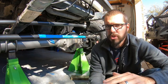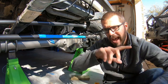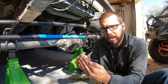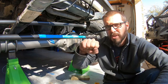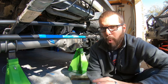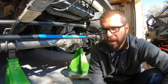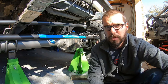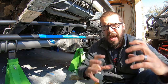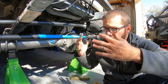That's not the best situation for long-term use unless you're aware of it, because as you turn all the way to one side, that ram will either be fully extended or fully contracted, and your steering box can put a little more pressure on the ram than it wants, and you'll blow the seals out on the ends of the ram pretty quickly. What I do is get to the end of the ram, then back off my steering just a tad to remove that pressure. It's always done me perfectly fine. Now let's get to measuring.